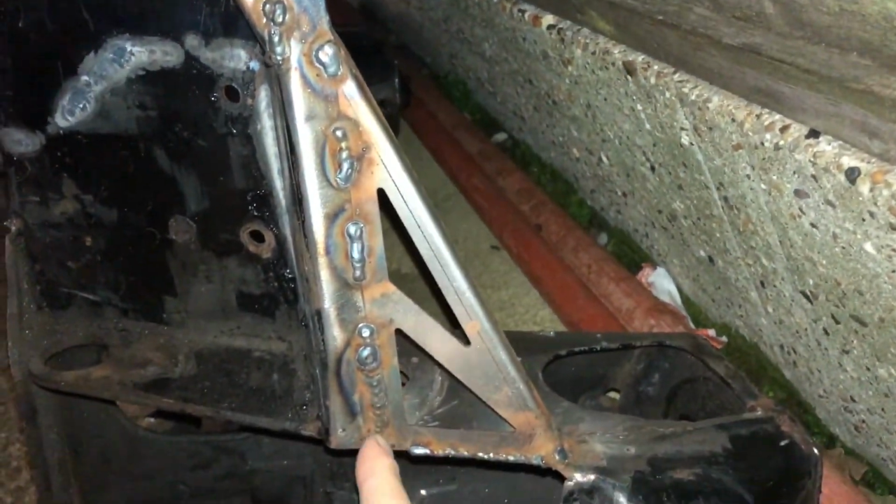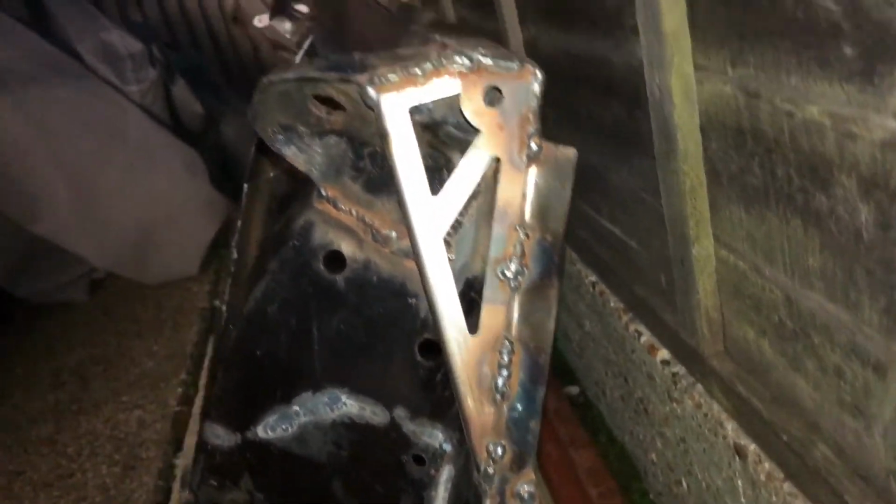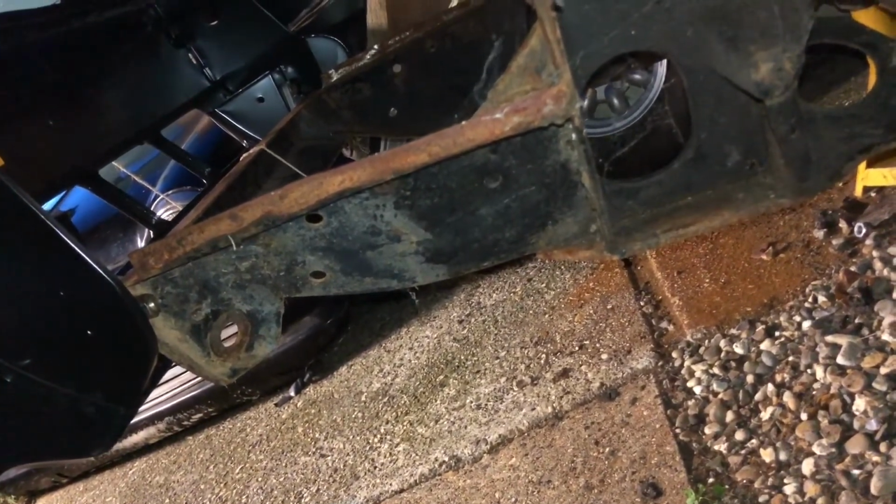Looking at the kit now, I'm just looking at the bits. I might be able to cut that off and refit it to this one. That's some thought, isn't it? Scrap all the seam welding idea for now. I could leave it bolted to the car, tack everything where I want it, and weld it up. I've got a thin blade. Down here, I literally run a cut down there, run a cut there. I could cut this kit off, obviously the damaged side being the subframe, and then do everything that I did here on here. That's a thought, isn't it?